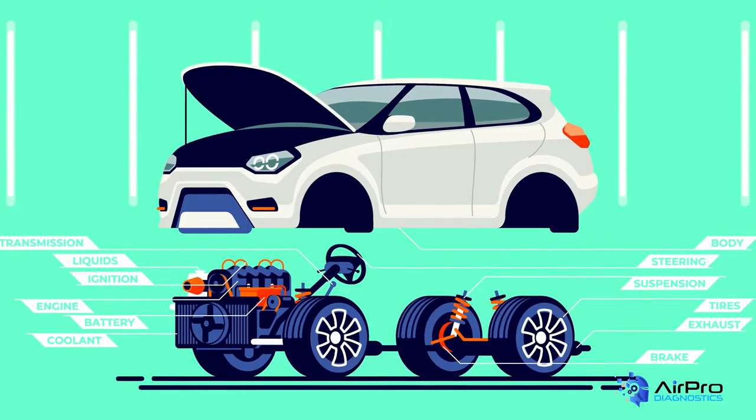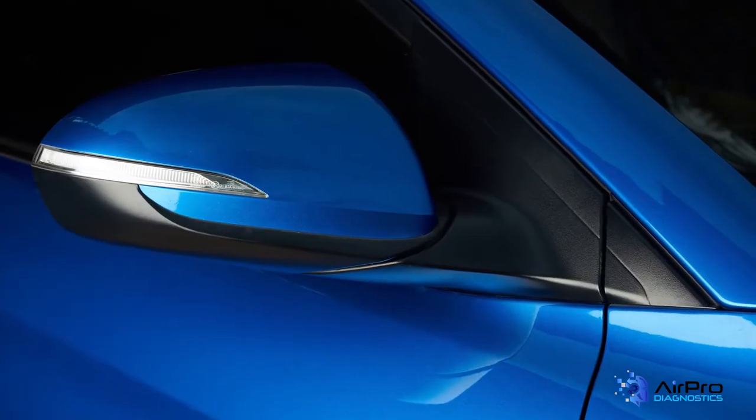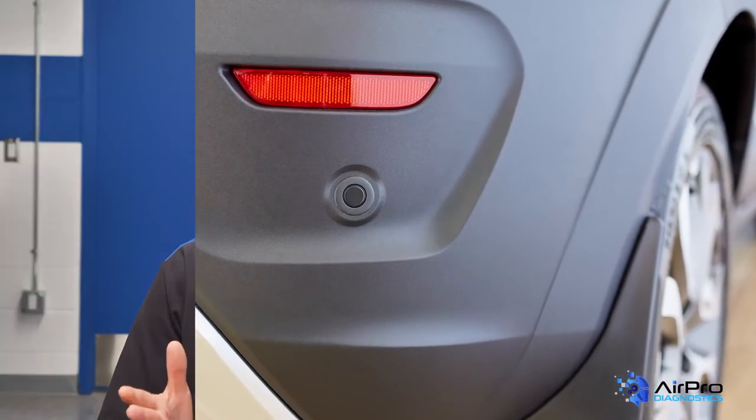Will you be repairing or replacing components? Remember, you will do lots of things in the body repair process that will set DTCs. For example, simply R&I-ing a side view mirror. Also, a simple dent in a quarter panel is no longer so simple, as there could be a crash sensor behind it. Just because you did not replace it or unplug a sensor, it still may need to be tested or calibrated to ensure the component does its job correctly.